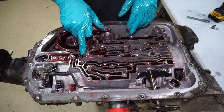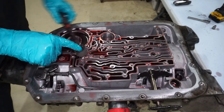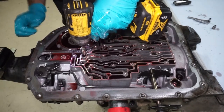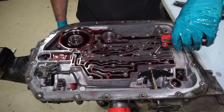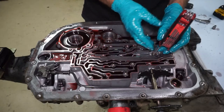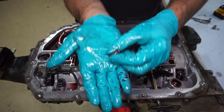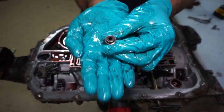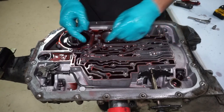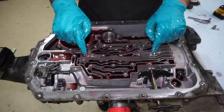So now that all that stuff's out, I'm going to get the center support bolt out and the fourth drum bolt, and then we should be able to tip it up and get the pump off. This is a three-eighths 12-point socket for the center support. The rebuild kit will have a new one of these — this one wasn't even tight, it was basically finger tight in here. It is important for these bolts to be tight because these are also oiling holes. The bolt has a hole through it — these are actually lube ports through the bolts. The center support bolt and this bolt use compression against the case to seal, so if those aren't tight, they can actually leak there.